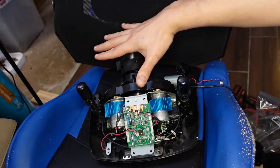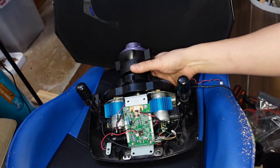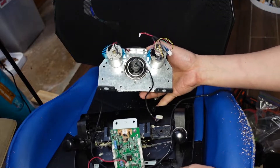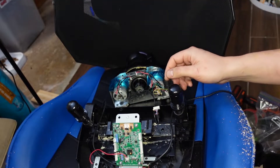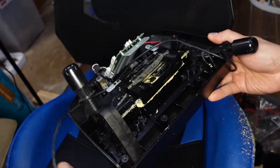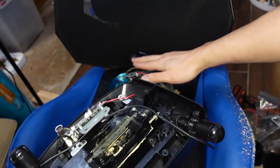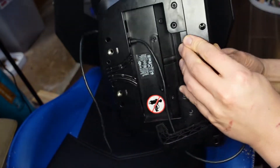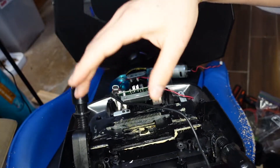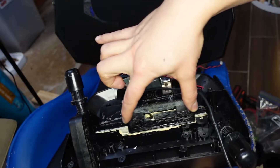To go over the general breakdown, there are a couple of screws on the bottom, the whole thing pops off. These are aftermarket ones, obviously. It has a couple of screws here, screws on the bottom, and this whole thing should come out with a couple of plugs. This is generally what you're interested in. One of the issues a lot of people have is if you start hearing clunking, especially at full lock — what's happening is the bolts that hold this piece down on the bottom are loose. It's these ones right here.